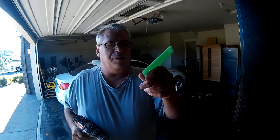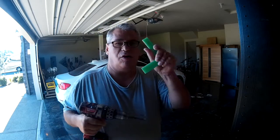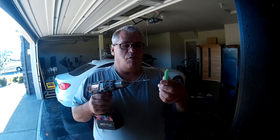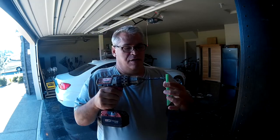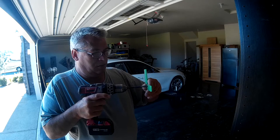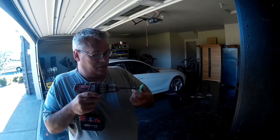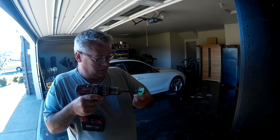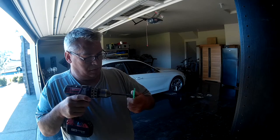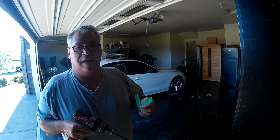Now, after drilling the little holes, we're gonna countersink the big holes. I would not advise going forward on this because you're going to drill, this is called PLA, it's very soft in terms of heat resistance and stuff like that. So if you go forward with any kind of speed, you're gonna drill right through this. I'll do the same to the other two holes. Countersunk well enough. And to the last one. Okay, they're all countersunk. Now we can install them.